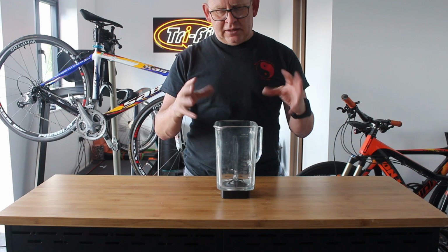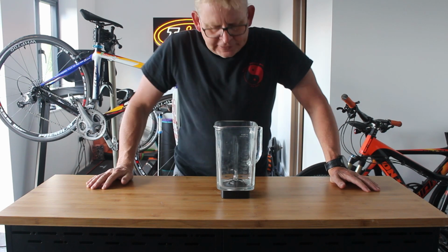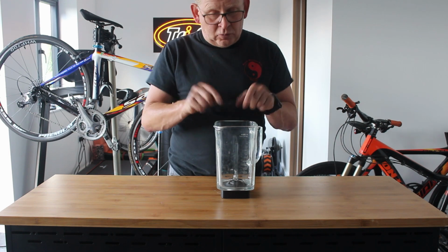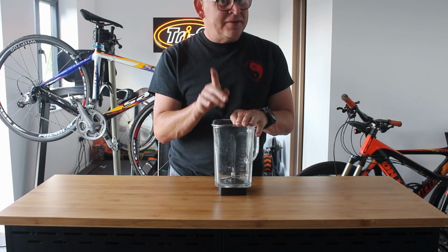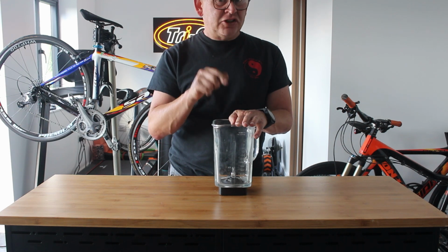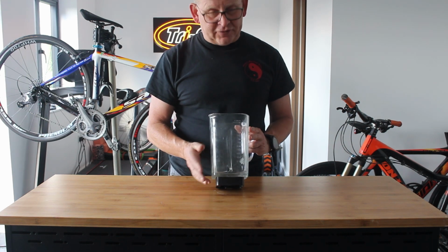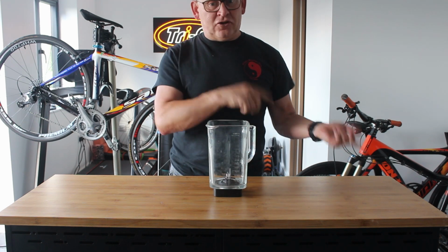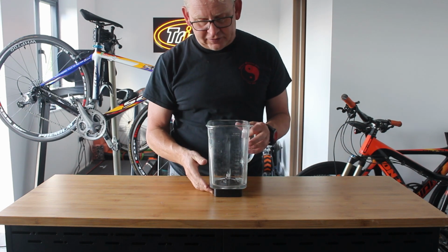It'll heat it up. I think if you saw Musty rebuilding a vacuum cleaner the other day, that's what that looked like it had done. It has spun and melted the plastic, but actually when he dug into it, it turns out it hadn't. The bearing had collapsed completely and lost its cage, and that's why it was off to one side. But we don't want to get to that stage with this, because all horrible things would happen if it got to that stage.